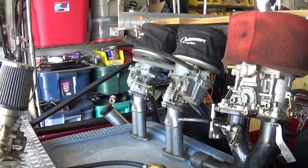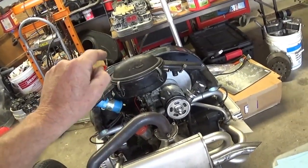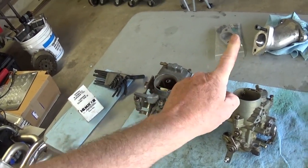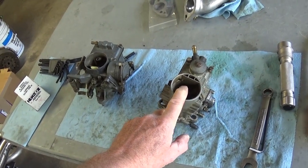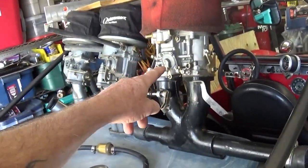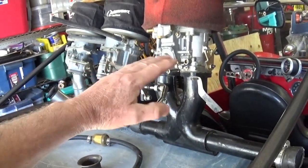If you run your engine lean with a retarded spark, your cylinder temperature goes up, your engine temperature goes up, and it shortens the life of your valves and engine. That's why all this has to be thought through and chosen correctly. The dual Kadron carburetors are perfect — they are made for the Volkswagen air-cooled engine and they work perfectly. The 30 pict has a 24mm venturi, the 34 pict 3 has a 26mm venturi, and the baby Dell has a 27mm venturi — another perfect carburetor if you have the correct linkage and manifold.